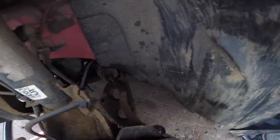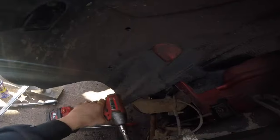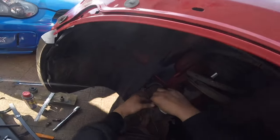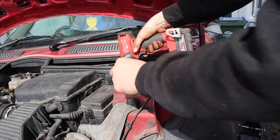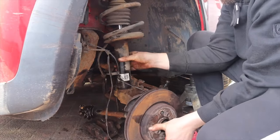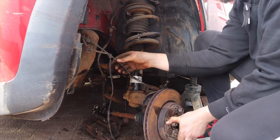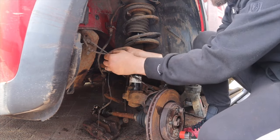The only issue is that the wishbone is essentially welded into that bush at the back, so I'm going to drop the whole suspension and get a better look at what's going on. Then it was time to get the caliper off, get all the drop links and stuff like that removed — the drop links are bent anyway so they need replaced. Get all the cables, ABS sensors and stuff like that out of the way. Dropping the suspension once everything's disconnected is very straightforward. There are three 13mm bolts holding the strut in place — just buzz them off, make sure you're propping the suspension strut up if it's jacked off the ground, then loosen it off and wiggle it down until it's free. And of course, I forgot to disconnect the ABS sensor — this one was already giving problems so it's not a big deal, but you'd want to disconnect it before.